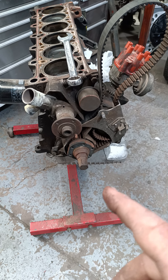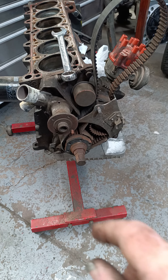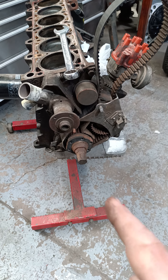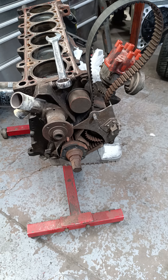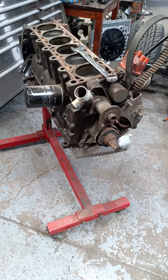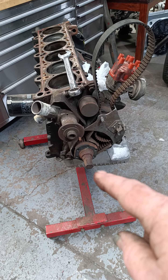The limit is set at 8,250. It's getting driven there. That should give us 400 RPM of wheel speed over maximum power. We're hoping 7,800, 7,850 is where our maximum power should be. We haven't even had it on the dyno yet, so we don't even know. We'll keep playing and see if we can pull the crank straighter and go from there. I'd rather not replace the crank if I don't have to.